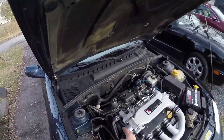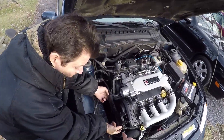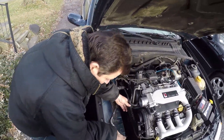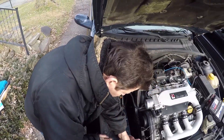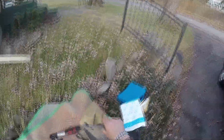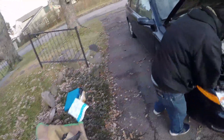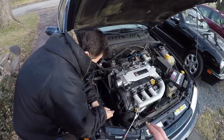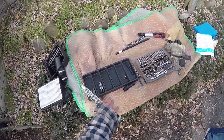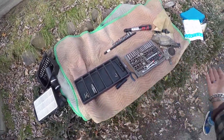You're gonna remove the air box, disconnect these two coolant lines here and get them out of the way. Remove the two T30s to remove this harness connector. You're going to need 15 and 16 mil sockets to get your motor mounts out. You're going to have to take the motor mount apart to get it out. On this one, the last bolt on the right hand side — you got to leave that bolt in there because you will not get that bolt back in if you try to put the bracket in and then get the bolt in. You're going to hit the body, so you got to lower that bracket in there with that bolt in place. So it's a few 15 and 16 mils. I got a little tray out here — it makes the job much easier. Pull your stuff out and lay it out in order.